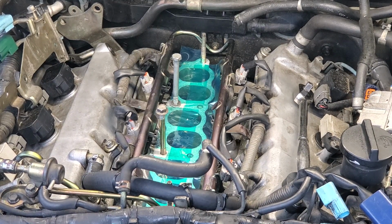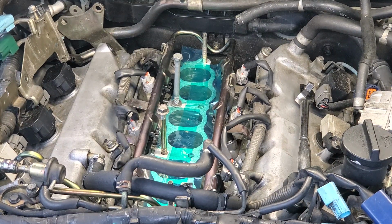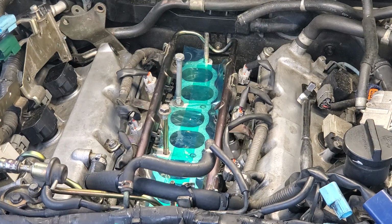drill and fill. We are going to helicoil this lower intake plenum, because the last person who worked on this went full ugga dugga instead of breaking out the calibrated torque wrench. So first thing I'm doing is I'm gloving up. I want to make sure I don't get any metal shavings or any of this highly flammable cutting solution into my skin.